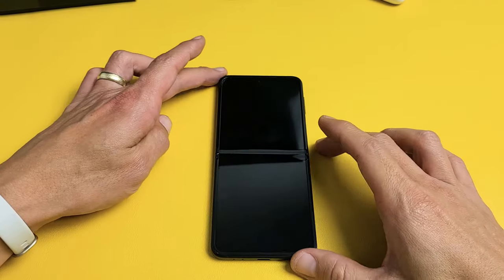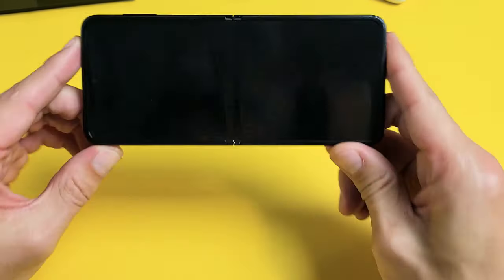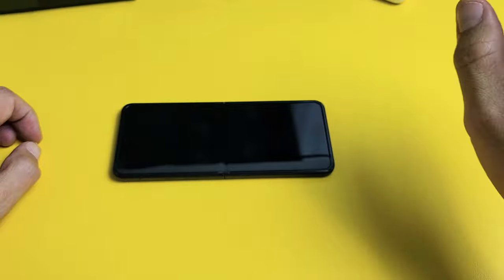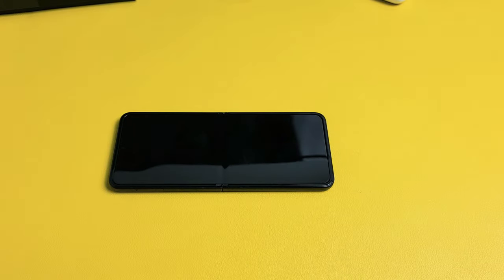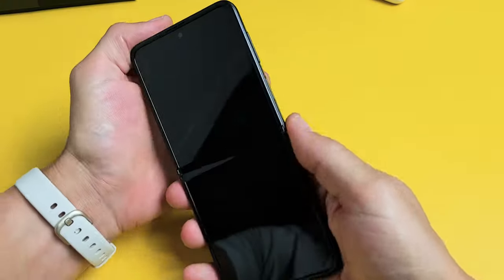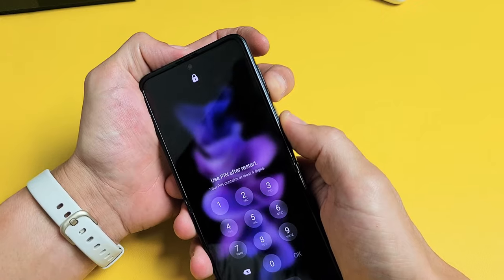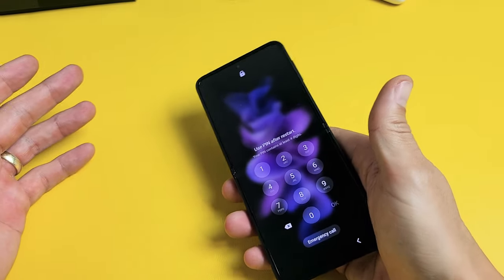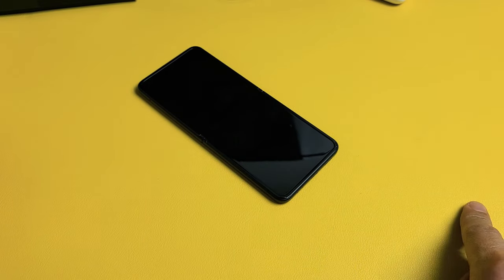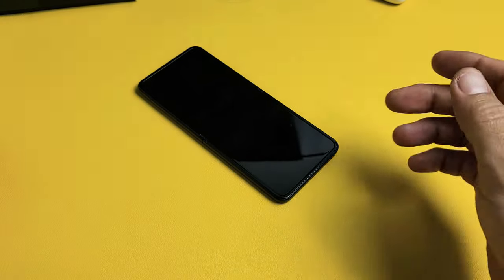If you've tried all of these methods and still have a black screen, the last thing I have for you is simply grabbing the phone and going to your freezer — the coldest part of your refrigerator. Put it in your freezer and leave it there for 15 minutes. After 15 minutes, come back, get your cold phone out of the freezer, and do the same thing — volume down, power. Press and hold both buttons and do not let go until you see the Samsung logo. If the freezer method still didn't work, start from the very beginning of the video and try every single step two times. Didn't work? Do it three times. Try it up to seven times, because sometimes seven times is a charm.